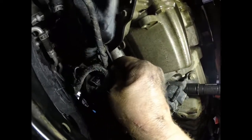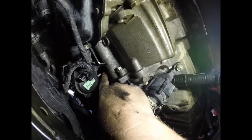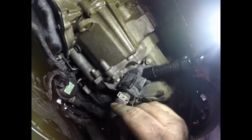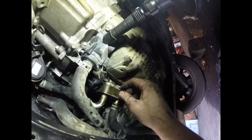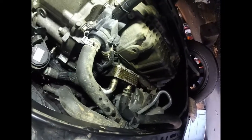So that is that cable right there — it is in. You have the two nuts for this bracket and they are actually 10mm. Once you are done with the starter part you are just going to put the oil cooler back on. There is a rubber seal on the back of it — check that and make sure it is good. It should be reusable, but if it has got high miles, go ahead and replace it. Then put it back up there and get the special bolt that goes with it.